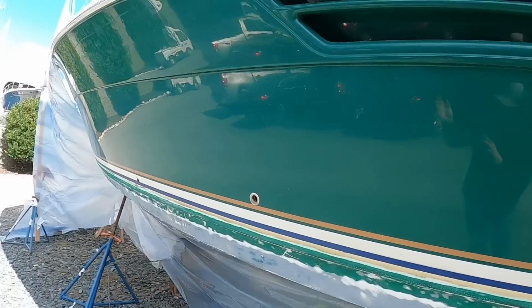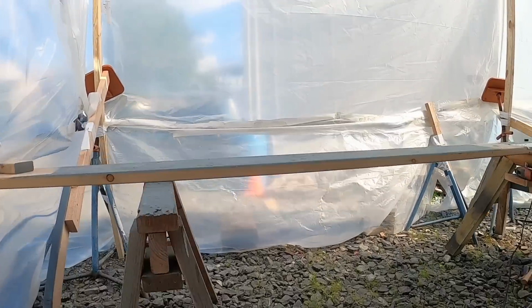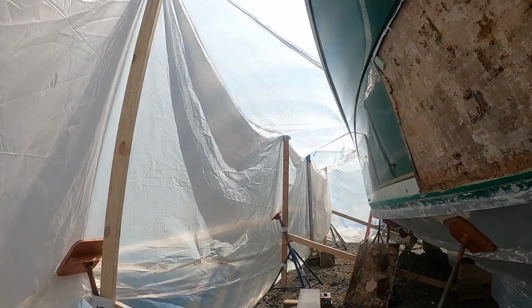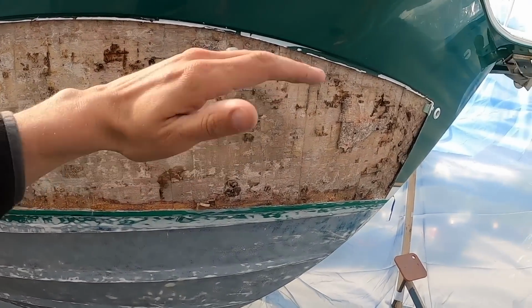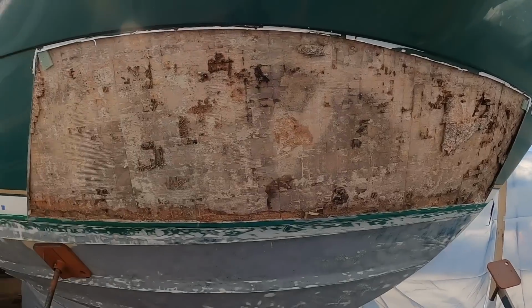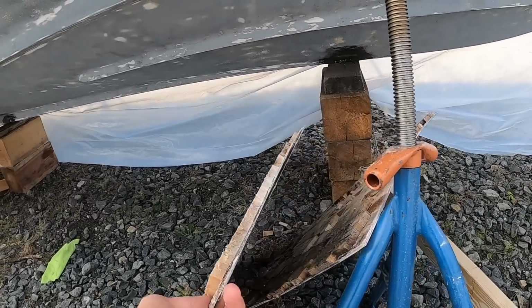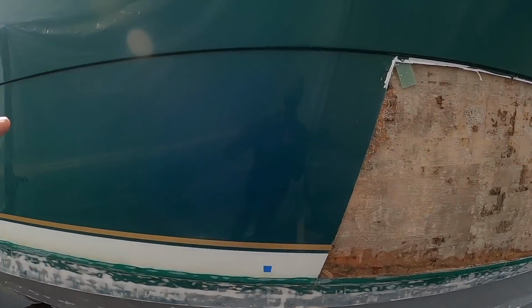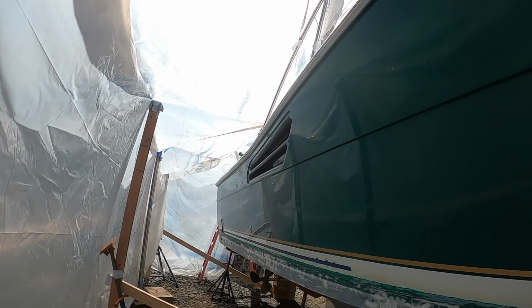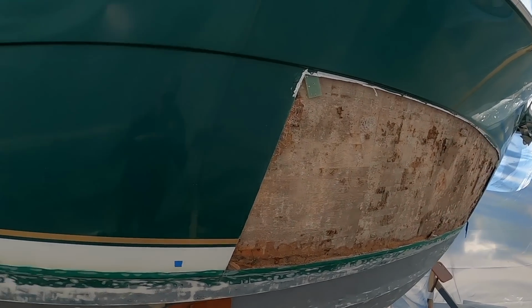And now, with a little bit of time and savings, I'm actually able to put the money into fixing the hull side properly. So I know this all looks daunting and crazy. Plenty of people have called me crazy. My own coworkers think I am too. But knowing what this issue is, standard delamination, balsa coring, 2 sides of fiberglass, and obviously the right team, that team of professionals that can actually do this kind of work, it's not as daunting. You just have to have the stomach to be able to get to the finish line and be able to make these cuts and dig into the boat like this and not just write it off as lost and broken.